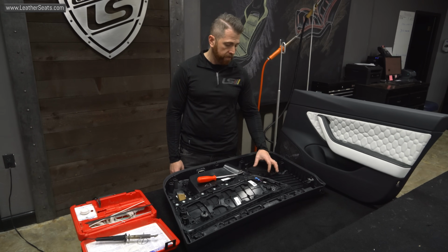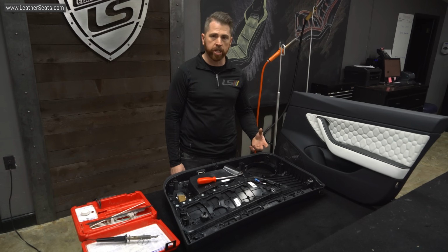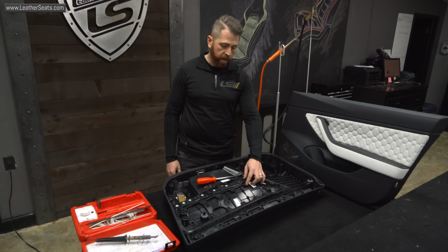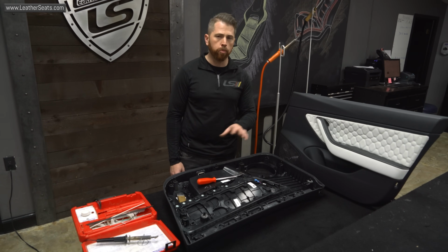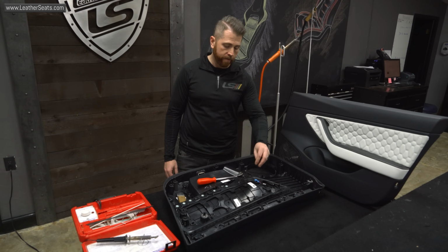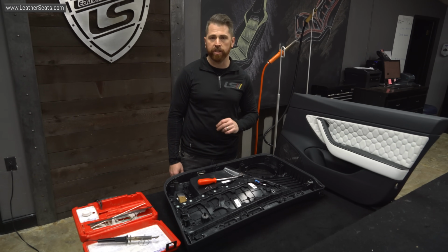I say welding specifically because the core plastic and the door insert plastic are both polypropylene, which means that a plastic welding iron is going to create pretty much a permanent bond at each of those 37 points. That whole process is really time consuming, and if I ever wanted to get the door panel insert out for any reason, I'd have even more of a mess than I had the first time.